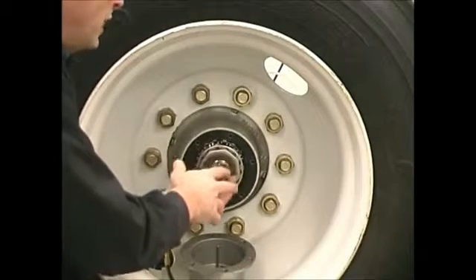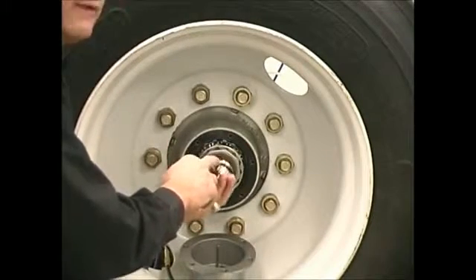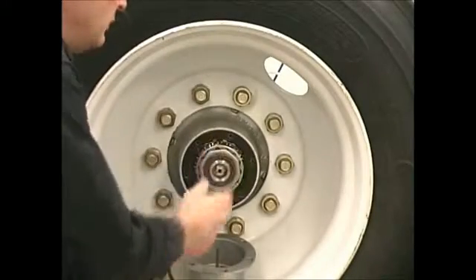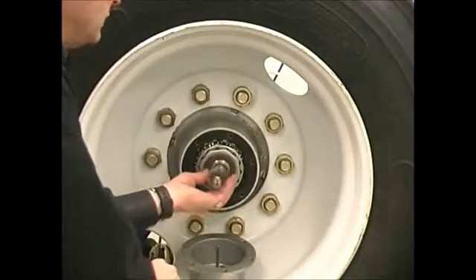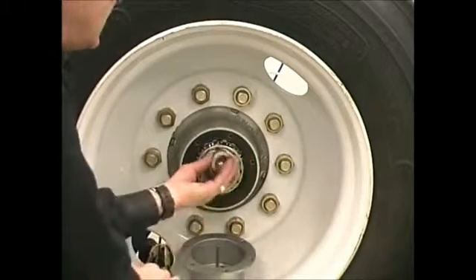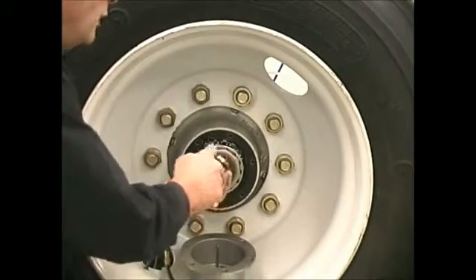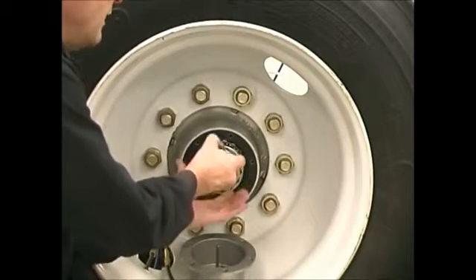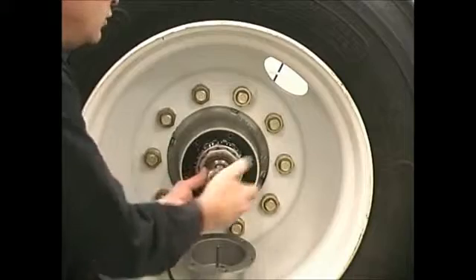If this is a brand new install, this might have been a leak point. But if this is an old install and you just developed a leak, I would suspect it is not the axle plug or the O-ring around it, because once it's in there it's stationary, it's already made a seal, and it shouldn't begin to leak.